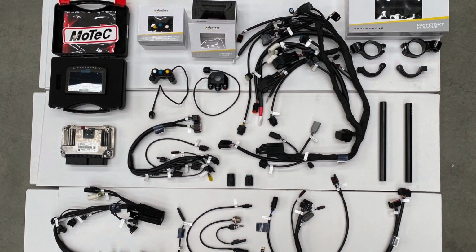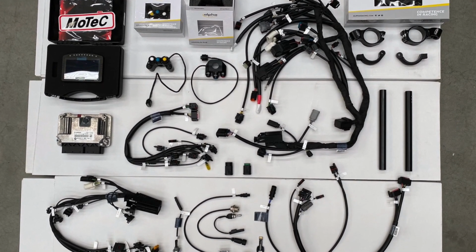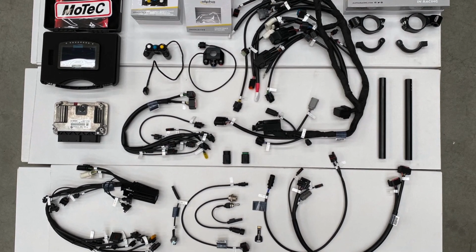As a road bike, it works four together, so they don't act independently. But as soon as you've got the race kit on, the BMW calibration kit like we've got, they can act independently. So Dave Carnell has given me a rider mode where all four work together, and a rider mode where they work separately. The idea behind these split throttle bodies is that it basically reduces the power, and it's kind of a prevention for traction control rather than traction control being the cure.